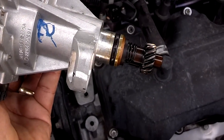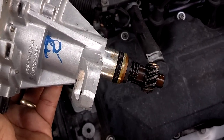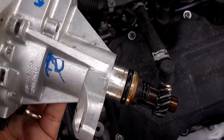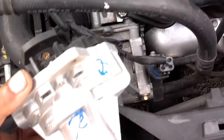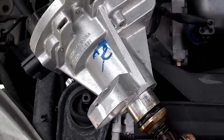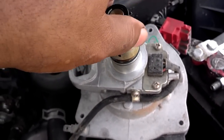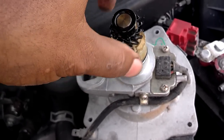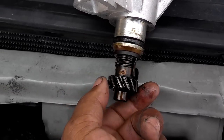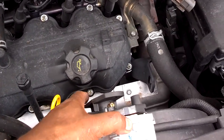To test the distributor, grab the shaft — you may want to put some gloves on because it's oily — and rotate it back and forth. It should rotate in a smooth, fluid motion without any binding or funny feeling. This one actually feels like it's binding a little bit; I can hear it clicking as it goes around. The one from the salvage yard rolls nice and smooth and actually spins freely, whereas this one just turns and stops.